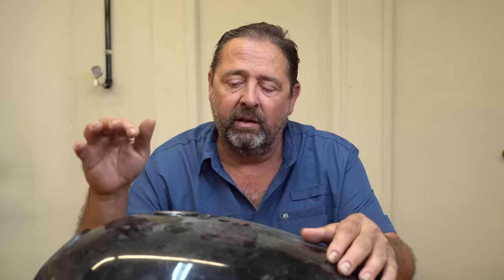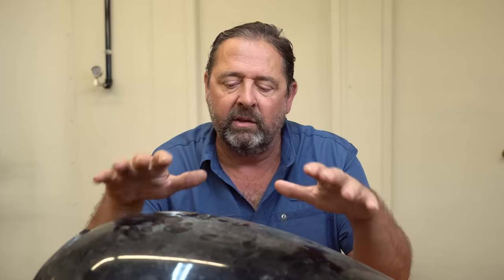So what I'm going to do now is put muriatic acid in here. This is a three and a half gallon tank, so I'm going to use probably about a half a gallon of muriatic acid, then seal the top of the tank with some really good tape and go outside and just swish it around in there. You do not leave that sit in here - I do not leave it sit for minutes at all. This is just like 40 seconds. What it will do is knock out that little bit of etching rust or flash rust that happens whenever you clean the tank. If you don't treat it with oil right afterwards, it's going to flash rust, but it's just minuscule - you can pretty much spit on it and rub it off. It's not thick rust. We got the bad rust out.